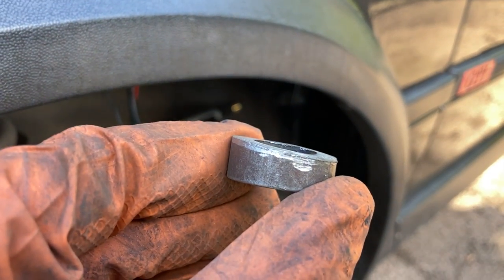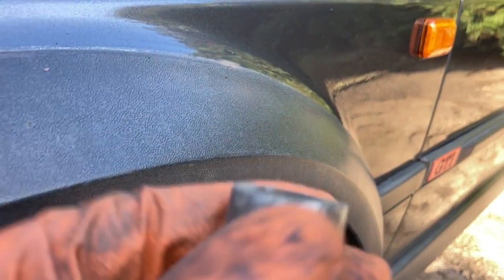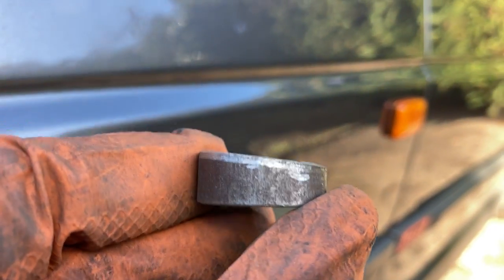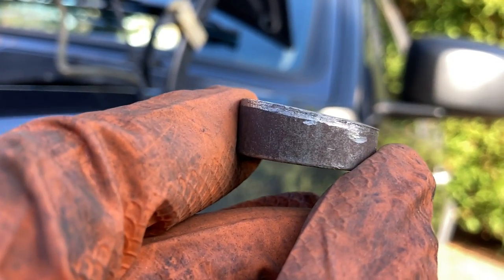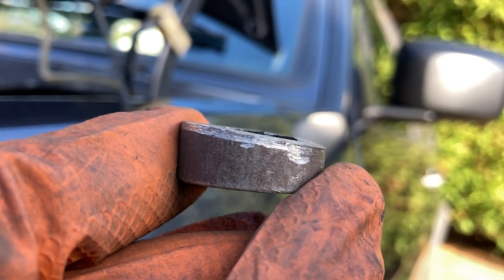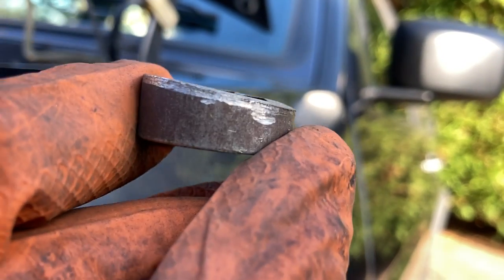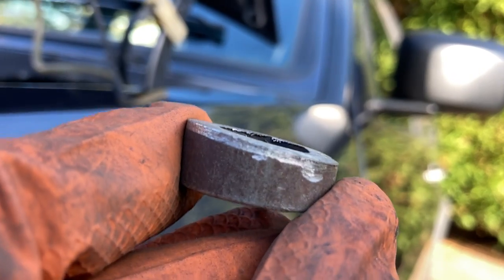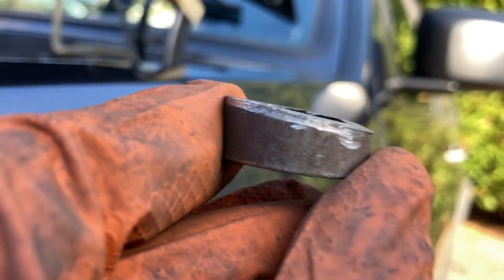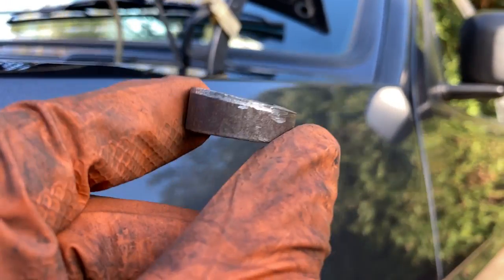Instead I've used this — a washer that I don't need to drill the wing to use. I've ground down the thread so that when it goes in the wing it's flat at the bottom. The key thing is to have it located square, 90 degrees to the ground but flush in the wing. That's what the adjustable bracket does — you turn it to get that position. This should sit quite nicely inside the wing, and then I can bolt the outer bit to it and it's all nice and secure.